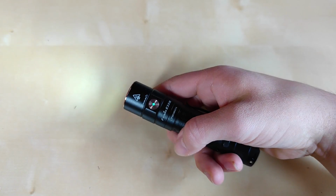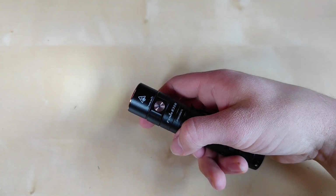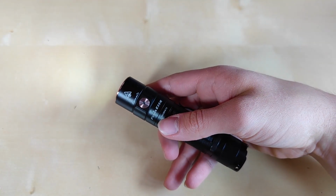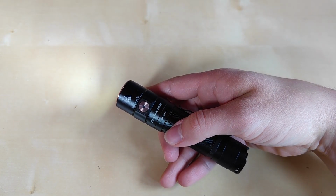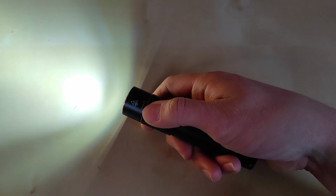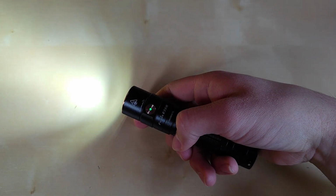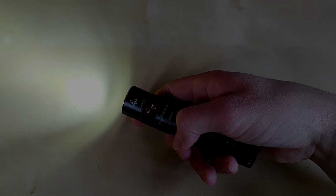When the flashlight is on, we have to hold the switch a little bit longer, then we've got strobe. Single click, we advance to the last used mode. Bear in mind that Fenix E35R uses the mode memory, however it does not memorize turbo, high and strobe mode for safety reasons. So whenever you are in the turbo output and you turn off the flashlight and turn on again, it will go into the medium mode. Same goes for the high mode and strobe mode.